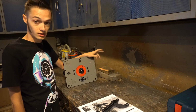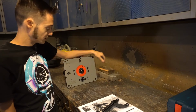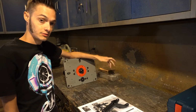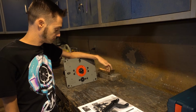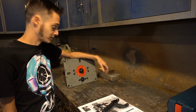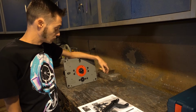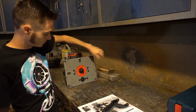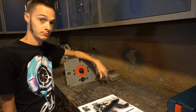And then we'll be able to start jigsawing out our frame gussets, our frame bracing out of masonite. Then we can router it perfect how we want it. And then we can take them to our friend at his laser shop and he'll trace out the masonite, put down some 3/16 plate, which is what we're gonna use to plate the frame with, because it's an 1/8 inch frame. We're not gonna use quarter because of that. So then he'll put down some 3/16 steel and then cut out our pieces that we made with our router. And then we'll bring those home and weld them onto the truck.